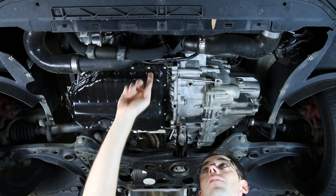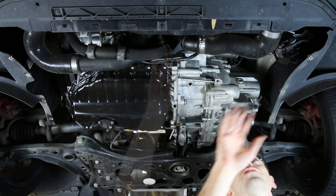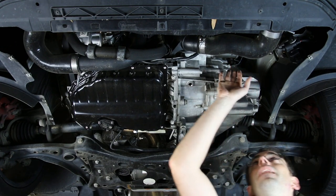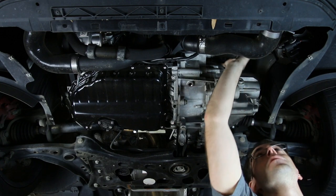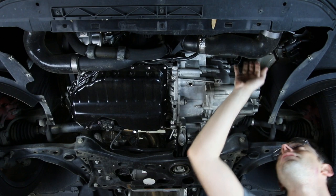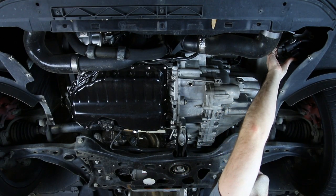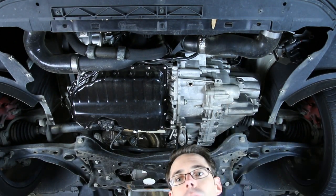This pipe goes straight up to the throttle body itself. Your fan would be mounted right here on the radiator support, and your starter is mounted straight up here on a manual transmission — keep in mind on the DSG this may vary as far as location, but it's very accessible on manual transmissions and easy to get in and out. Our secondary air injection pump is over here mounted up on a bracket, and again these hoses come up from the top where we talked about earlier. Thank you so much for watching our Mark 7 component location video. If you like this video, be sure to give it a thumbs up and subscribe for more like it.